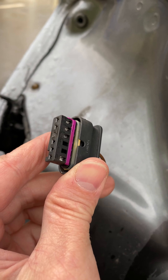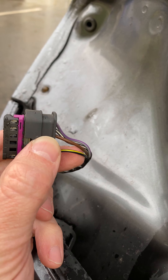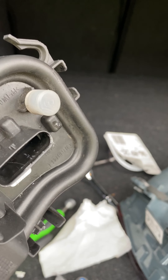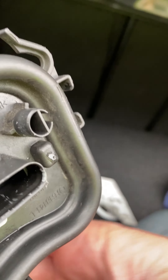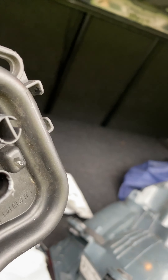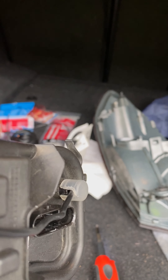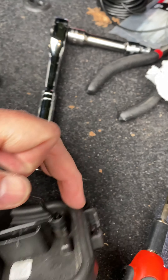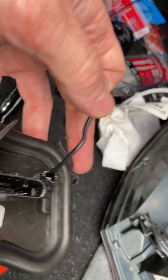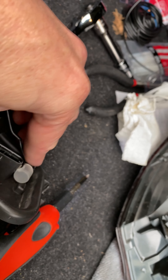See the harness side as well, where it's melted out right there, which goes to the brown cable. So you detach the brown cable, and on the back here you've got the spike cap — just pull that off and run the wire through it. I loosened mine up, so I cheated. Then you just run that black wire right through it. I notched out a little spot with a soldering iron, a little notch out of the side and a little one in the case, just to make everything fit nice and snug. I notched out a tiny little thing to set the wire in, bend it over, and then slide it snugly over the wire.